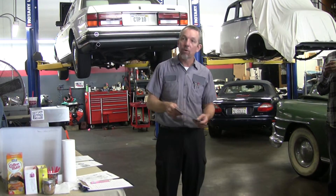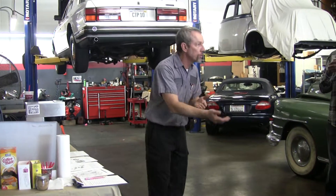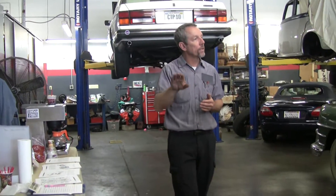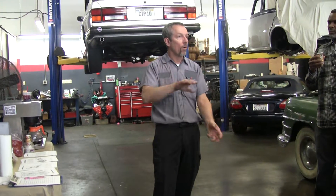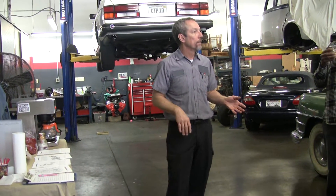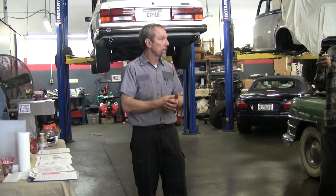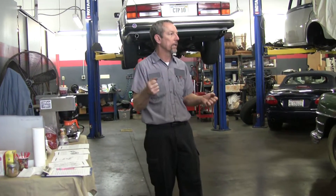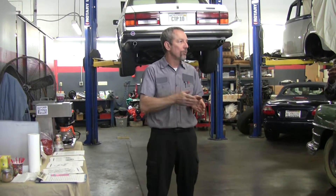This is the donor car, in for service. The transmission was shifting real harsh and didn't downshift properly. So much of the shifting quality is controlled by the throttle valve - where you put your foot on the gas. If the linkages are loose or out of adjustment, it's going to confuse everything. The governor tells the transmission it's going a certain speed, and if you're at the wrong throttle, it gets confused - real herky-jerky. Especially that 2-3 shift is the worst.